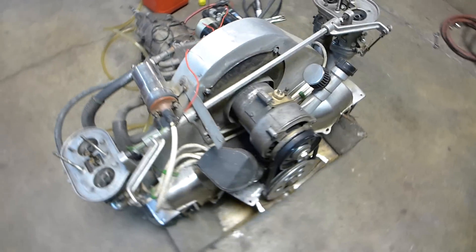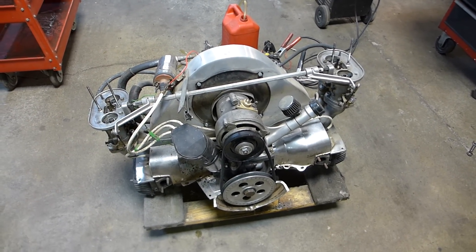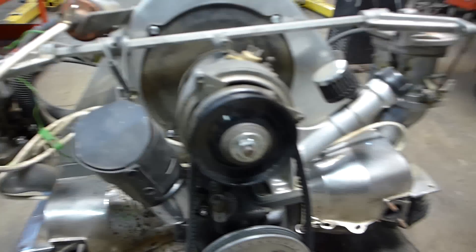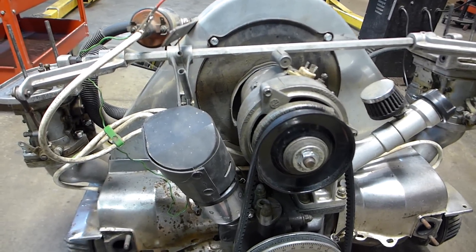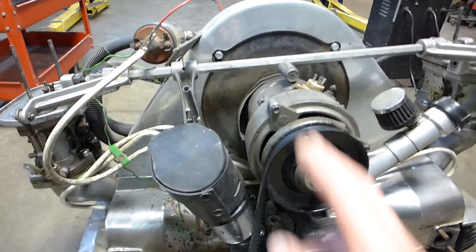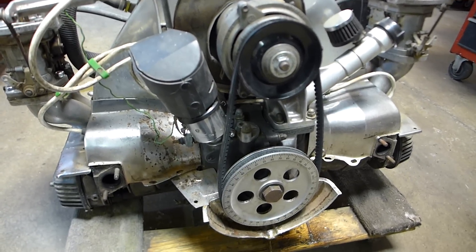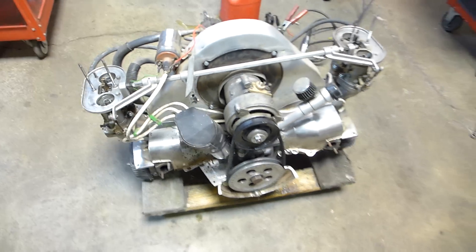But I was told it was good and I was gonna put it in my little Vespa car that's Volkswagen powered. However, the carburetors — because they're dual carburetors — they stick out and I'd have to cut the bodywork. That's not gonna work. So right now I have the center carburetor and I'm just gonna leave that for now — it's running really good. This actually might be too much with the higher compression, the bigger carburetors, and I'm not sure about the cam. We're gonna try to fire it up.